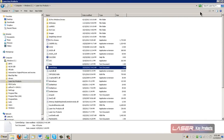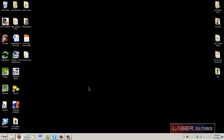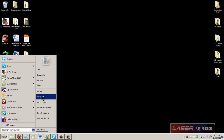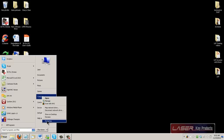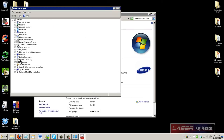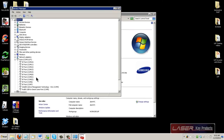The next thing you want to do is minimize this. Then you want to go down to the start menu, right-click on your computer, go to Properties, Device Manager, and then your port settings. In here you should find right in this area what port your software is set up for.